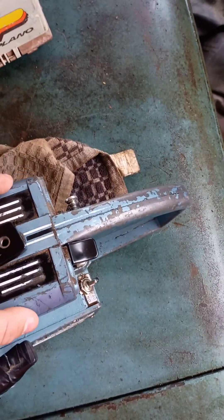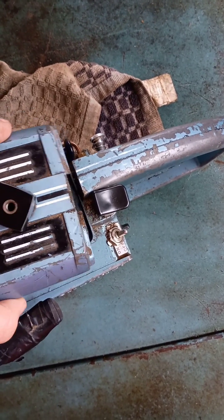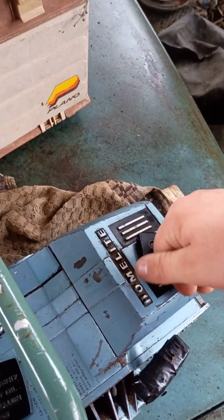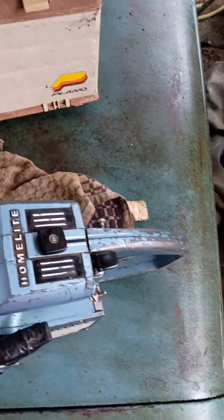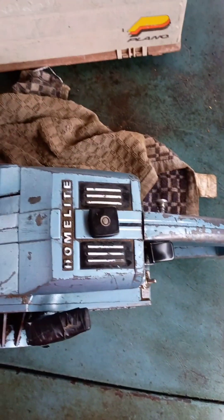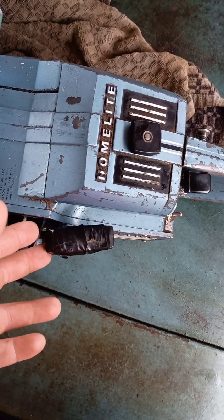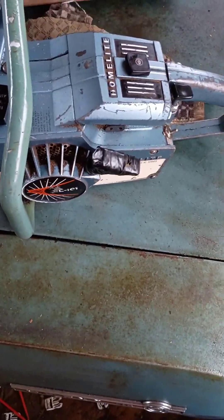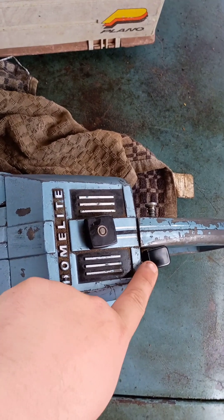Most people buy a broken saw to restore, but I bought this one just to play around with. I actually bought another saw — a Homelite XL-12 — to restore my old bow saw that I have under the barn. I'm going to paint it using the correct Homelite color combinations, and I ordered a new spark plug and a new pulley system because the current one is all warped. This one will probably need one too based on the screeching noise it makes. I also got a new oiler for the XL-12 because the seals are all shot.